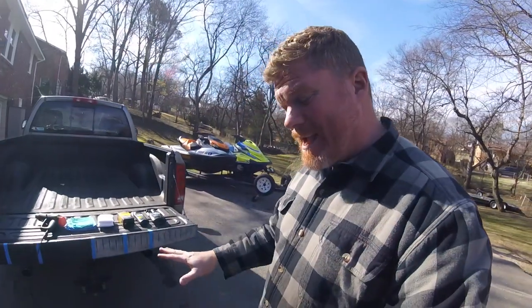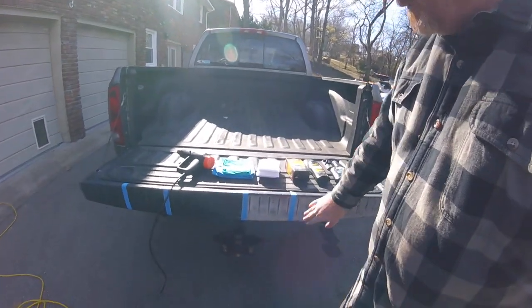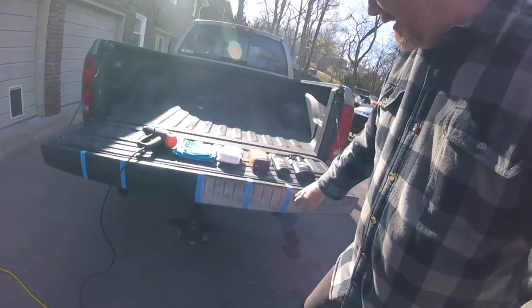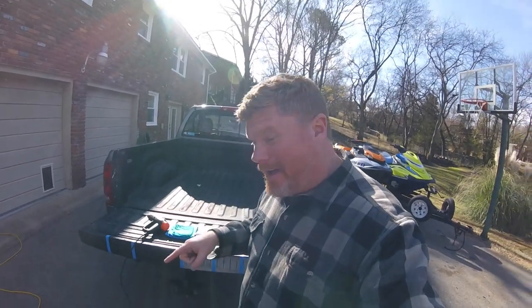We're talking today specifically about sun-damaged plastic. You'll see I've already heat-gunned this half, and this other half is what it looked like before the heat gun. I'll show you live how the heat gun changes the plastic. If you do it right, you'll keep your texture, restore some black color, and then you can get better at keeping your plastic looking good.